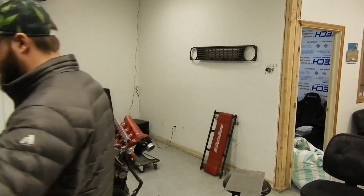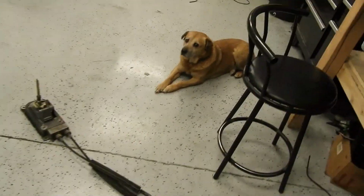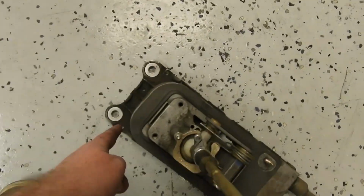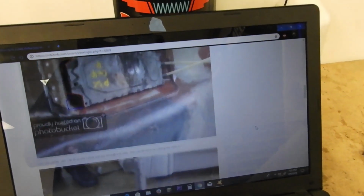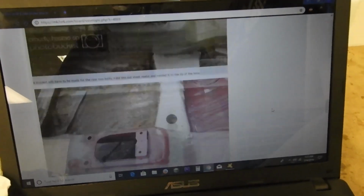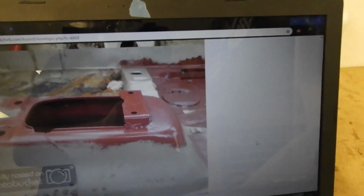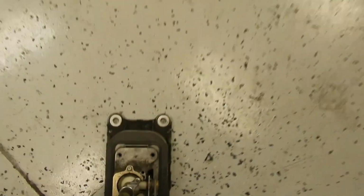All right. As you can see, we got the pedal in. Now I gotta get the shifter box in. So we got to cut the OG brackets off this Mark IV shifter. And we gotta make some stuff here according to the forms. Don't know who made this form, but I give them credit. So yeah, it says cut, cut, cut. And then we gotta drill out the holes there and make a little bracket like so. That'll bolt to these guys. Let's get it.